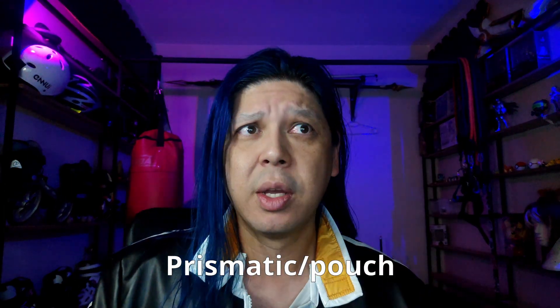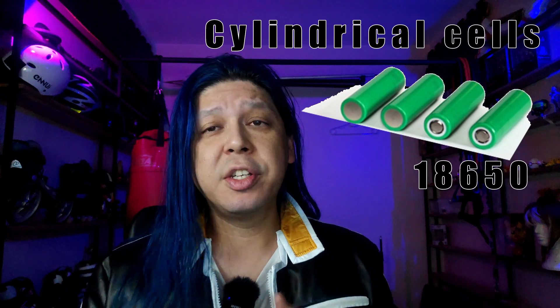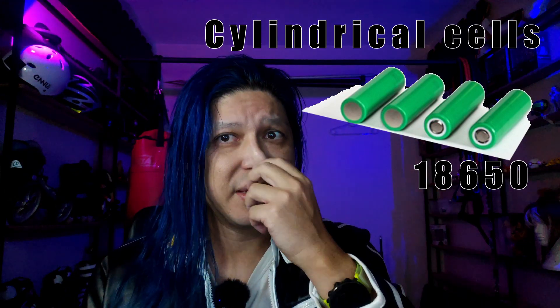Today I'm going to show you what I bought. One of the main problems of the electric landscape is the battery — it's like one of the big puzzles with the motor. I would like to use the prismatic LiPo batteries, which are the same used on drones, but most of the motors we use right now run a 36-volt system. It's really hard to find LiPo prismatic batteries for 36-volt systems. Usually 36-volt batteries are easier to find in the cylindrical format instead of the prismatic or pouch kind, because of the volume — it's squared, so it fits better.